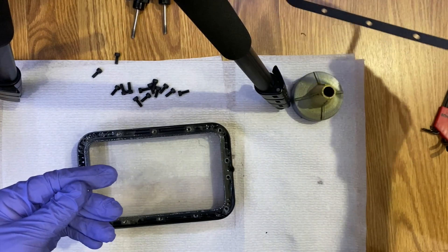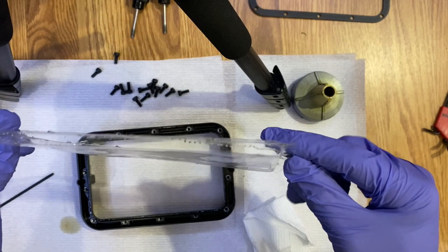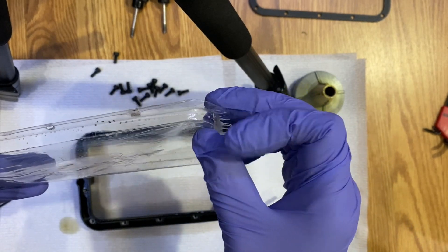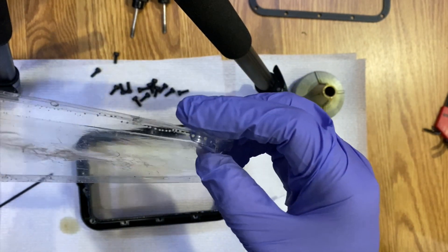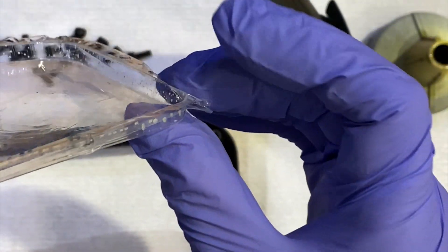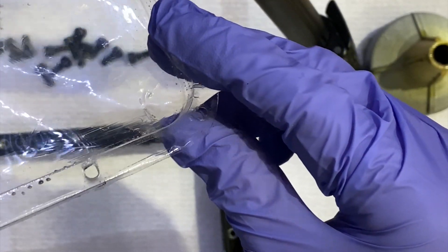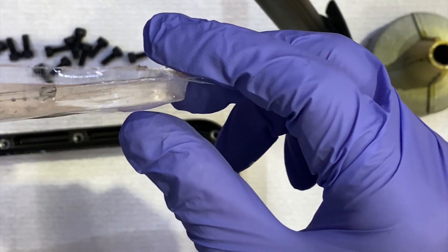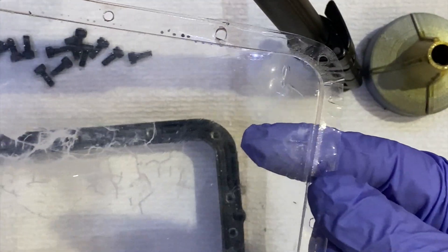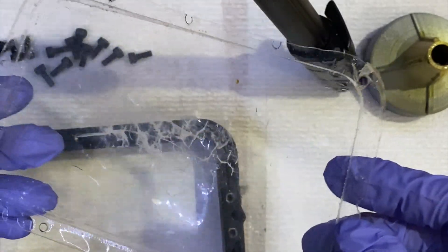Now this one is clean too. Remove your vat — this is my vat. You might ask what the damage was. If you zoom in, you can see this part got lifted up, causing wrinkles on the print. It's like a loose flap. Yes, we removed it — there was damage and it was time for me to move on to a new vat screen.